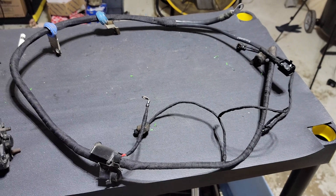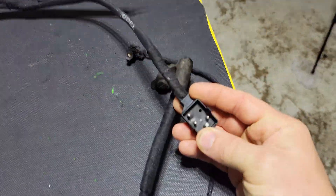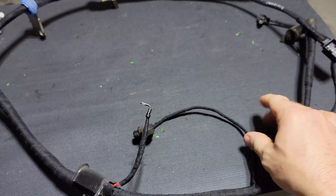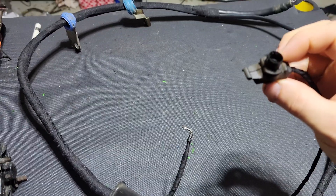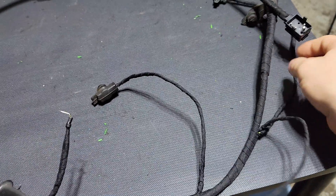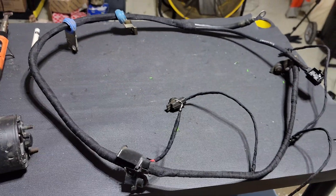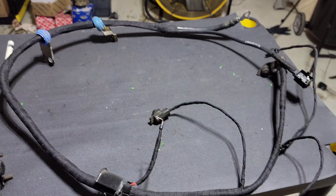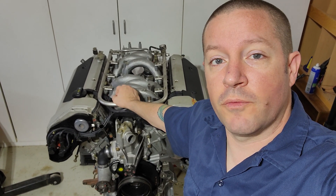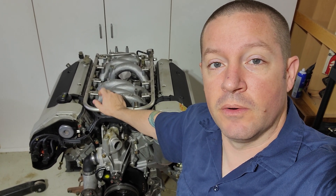There we are — got a little tape happy with it — but went through and tested all these with the ohmmeter, and made sure I got good continuity between all the opposite points of all these connections here. I guess that's it for this video. Next video we'll get to putting it on, possibly putting the upper harness on as well — maybe. Don't hold me to it because things always change. Thank you for watching. Don't forget to hit subscribe, give me that thumbs up, and hit the notification icon so you get notifications when I post a new video. See you next time.